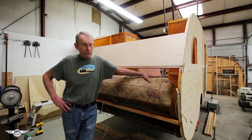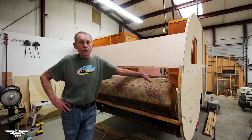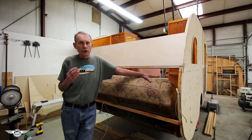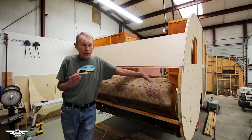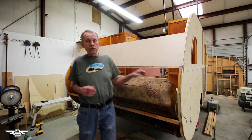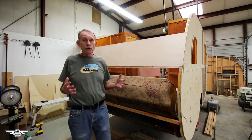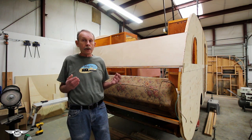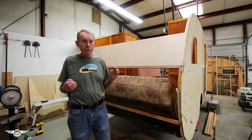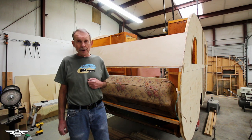There's something I'd like to share before we get started on the wrap. I've always taught — and you've been hearing me preach on this for quite a while — about how these trailers are built in a unibody style. That means everything in the trailer is helping to hold everything else together. A lot of cars are built like that, especially today. They used to have their own frame and now the frame is part of the body. It's a unibody style so the entire thing needs to flex. Jet aircraft flex, all airplanes flex, trailers flex. Everything that moves should flex a little bit — that's why your house is not built to go traveling down the highway over bumps and through potholes at 70 miles an hour.